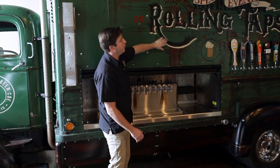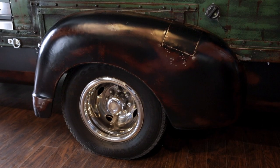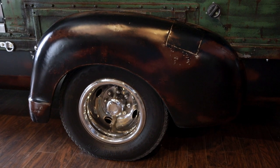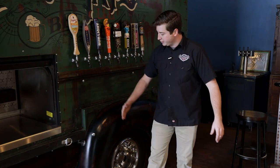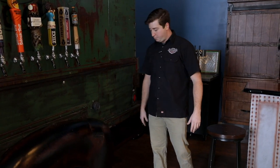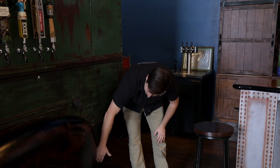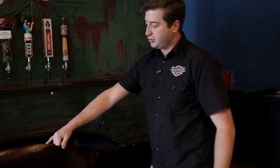We didn't do anything with the original patina. We added our sign — all hand-painted, my sister actually did that. We made this fender from a 1956 Chevy truck — it's actually the rear fender where we sectioned it and filled in the gas hole. We sectioned it so it would follow and flow around there and tuck around the wheel. The fenders are actually flipped; we liked that little square rolled edge on the face — it looked a little bit better once we held it up there.